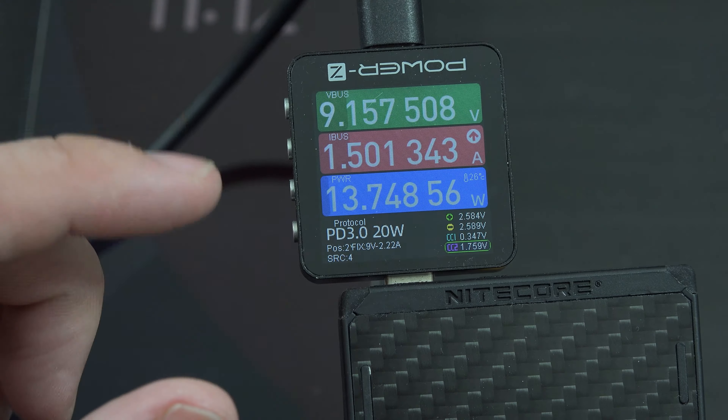Connecting up the Google Pixel 8 Pro — the 9 Pro just got announced but I don't have one. Right away I'm seeing PPS, and that is fantastic. That means it's going to charge up your Samsung device at a very good speed. You should actually be able to get all 20 watts out of this, which is something most power banks can't say unless they support PPS. The PowerCore 10K Slim does not support PPS, and a lot of small power banks don't either. So that's amazing.